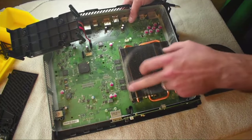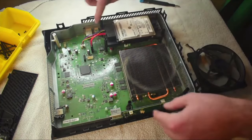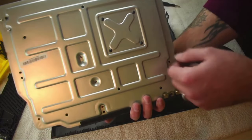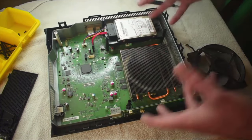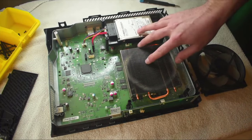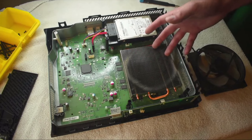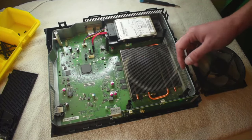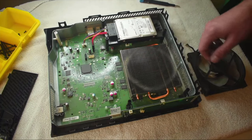If you look down in here you can actually see some dirt built up on the heat sink. If you're wanting to get all the way down to the processor, this metal tray is just sitting in the plastic — lift it up and there are four Torx screws, and that heat sink will just come right out, just like a PC. For cleaning purposes, we're not going to be removing that. We're actually going to take this outside and blow everything off really well. We'll use rubbing alcohol on the exterior of the case — you don't really need to use anything for the interior unless something was spilled. If it's just dirt and dust, just blow it out, and use the alcohol sparingly on the plastic.